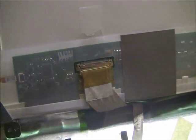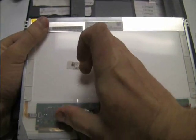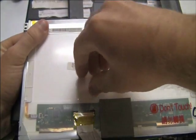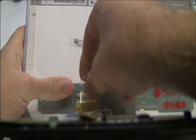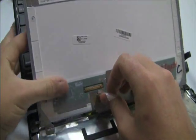And then here you can see the culprit of the black screen — just that ribbon cable. Due to either defective tape or poor design — I'd say poor design. And then start scraping away at that tape, and just kind of pull it upwards away from the LCD. It should pull out pretty easily.